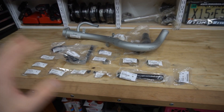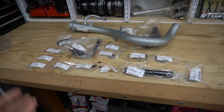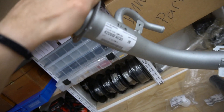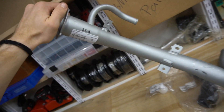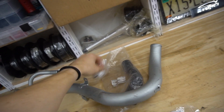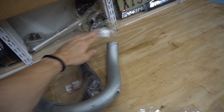So let me show you all the parts I got to replace the fuel fill pipe and the surrounding pieces, and then we can jump in. So right here laid out is everything you'll need. I probably didn't have to replace some of these things but while you're in there you might as well. The main piece is the fuel fill neck — OEM Subaru part. Then there's a one-way valve that goes in the bottom of the fuel fill pipe, so replacing that in there.